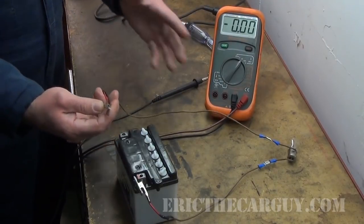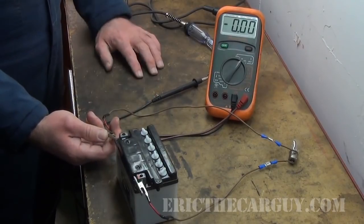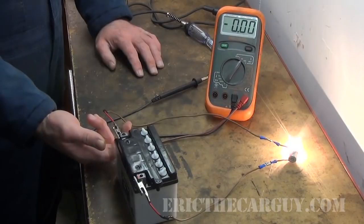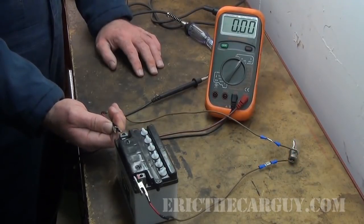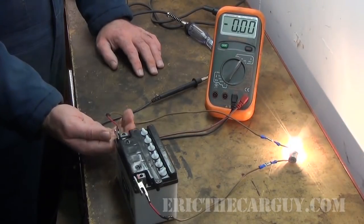And that is important. Why? Well, it's important in troubleshooting. When it comes down to it, that's really why a lot of us are here — you're trying to figure out what's wrong with your car, what's wrong with the circuit, and you want to be able to troubleshoot it. We need to know circuit design before we can test it. What I mean when I say ground side switched or positive side switched — right now the circuit's not hooked up. This is the negative side of the battery, which would be the ground or earth. And if I connect it here, I just became a switch on the ground side of the circuit.